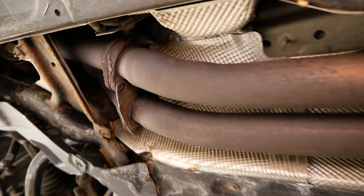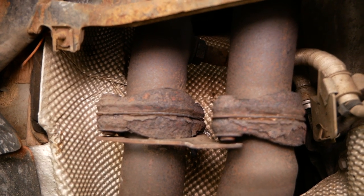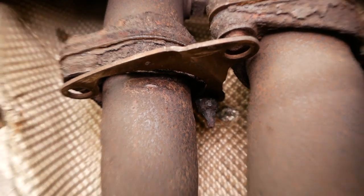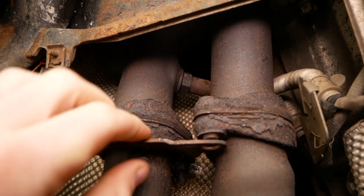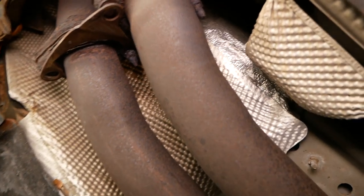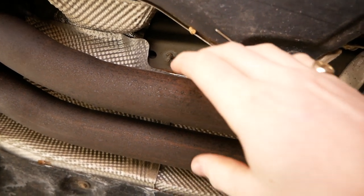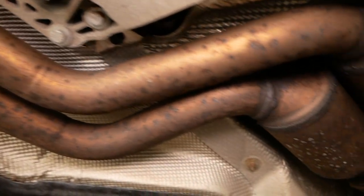Moving up to the front here, as you can see these exhaust flanges are extremely rusted. We cut off the two lower bolts and the top bolts — they're simply not coming off and we don't have any means to remove them. This is honestly so fused together we're not even going to try to separate it. It just occurred to us: why don't we just chop the pipes right here and then use some two and a quarter inch band clamps to clamp it back together? That's exactly what we'll be using — it'll make the drop a lot easier.